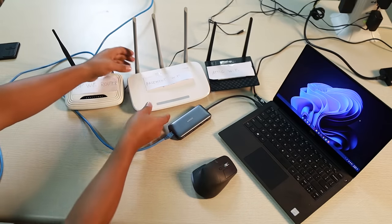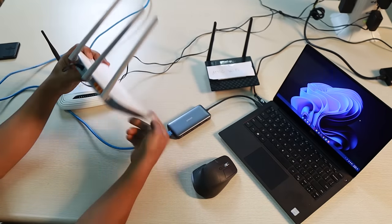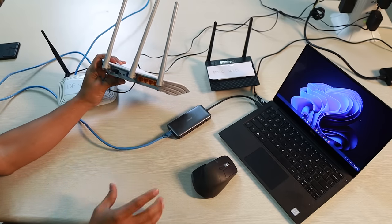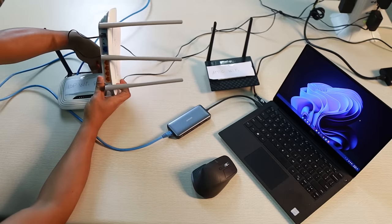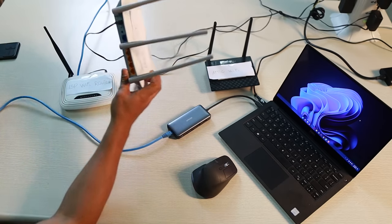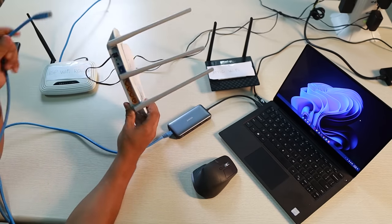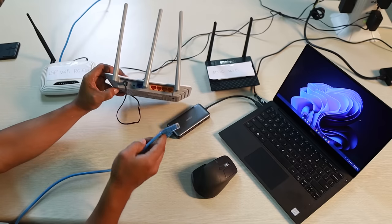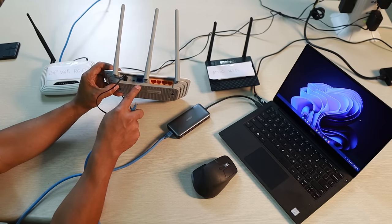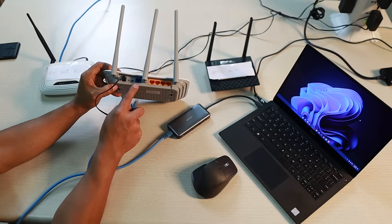I'm going to power on the basement Wi-Fi router and transfer my connection to it to configure it. Take note that while I'm configuring this router, it is not connected to the ISP router yet — nothing's connected, only my laptop. When configuring this router, you do not plug the cable into the blue WAN or internet-labeled port. Some routers don't color it blue, but they label it WAN or internet. Plug it into one of the LAN ports, numbered one through four.